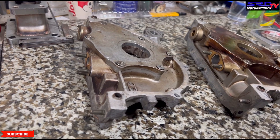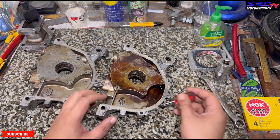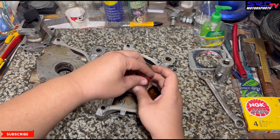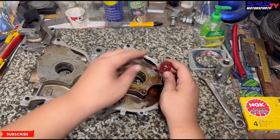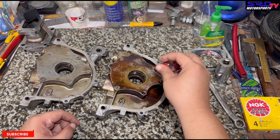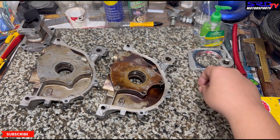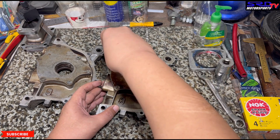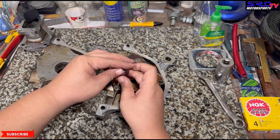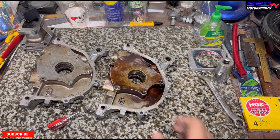Here is a B18C oil pump and a late-model B20 — '97 onwards. We're going to remove the cover and speed it up a little. The reason we're disassembling this is because the side clearances of the oil pump gears are what reduces — or actually wears out — and you start to have low oil pressure, which leads to low oil volume. The oil pump gears are steel and the housing is aluminum, so the softer material — the aluminum — receives the wear before the pump gears.